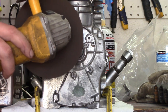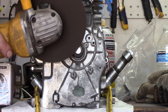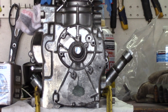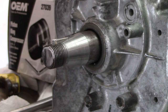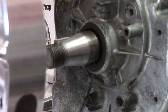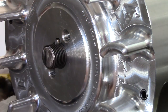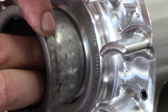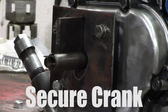What I'm doing right here is a bit unusual — nobody really needs to do this. This is just for a Briggs & Stratton 5 horsepower engine that has a long crankshaft. The old starters are longer, have problems with ball bearings and greasing, and end up failing. With newer Briggs & Stratton engines, and a lot of Predator 212 and modern OHV engines, they have this cup on there — no ball bearings — and they don't fail nearly as often. So I'm basically doing a mod on my old engine, putting the cup on there and using a modern side cover so it'll engage with the cup.